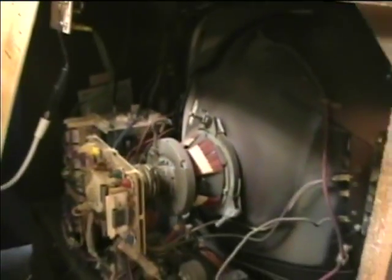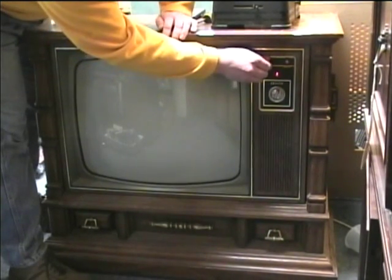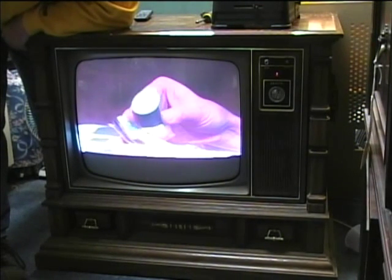Okay, we'll go ahead and give it a test. I've got it hooked up to the DTV converter here, so we can see what this old Zenith will do. I may not have the DTV converter on — it's not close enough. It's got a pretty good CRT, but you can just see that the vertical is kind of stretched out. I'm sure it's bad electrolytic capacitors.